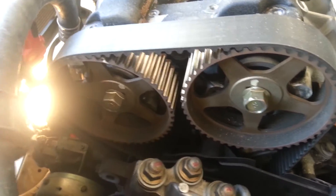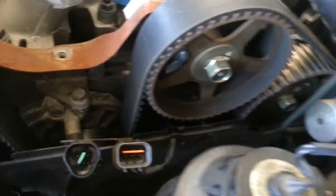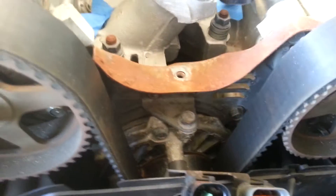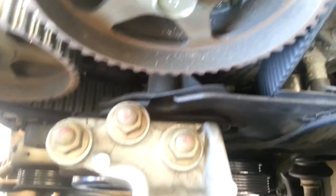You can also see I removed the two timing belt covers — not rocket science. There's about one, two, three bolts here and then another two here, so I'll take the covers off. And now I'm at the stage where I need to remove the motor mount.